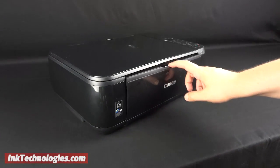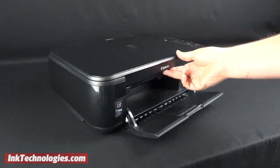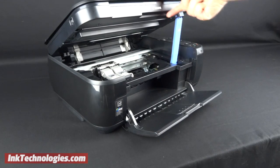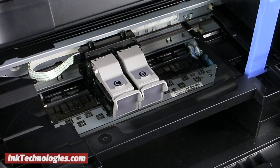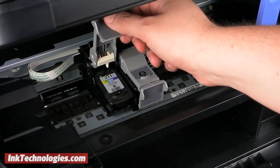With the cartridge prepared, turn on the printer and open its paper tray. Inside the opening, lift up to open the top cover of the printer. As you raise it, a plastic lever moves forward to hold the cover up while you replace your cartridge. The cartridge will move to the center automatically, then you can open the small cover marked C for color by pinching the small handles together.